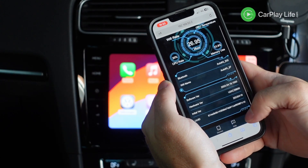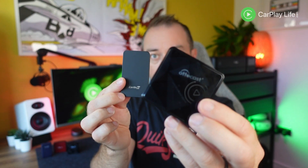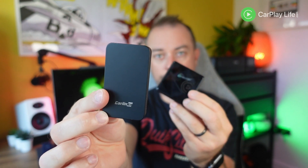If the dongle doesn't work at all and none of these tips work, and it never has worked, it might just be that your wireless CarPlay adapter isn't compatible with your car's CarPlay system. You can check for a firmware update for the specific dongle that might enhance compatibility for your vehicle, or you could send it back if you're within your return window and look at buying an alternative wireless adapter. If you've bought an AutoKit adapter like the CarLinkit kit, try an alternative like Autocast or similar. If you aren't using an AutoKit adapter, try using a CarLinkit adapter instead. Both adapter brands and their OEMs run different system codes with different compatibilities, so the alternative might work where buying another adapter with the same code base will just give you the same results.